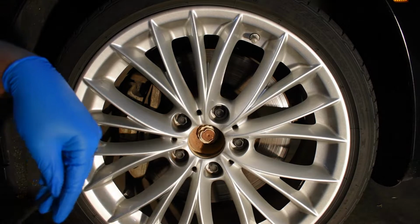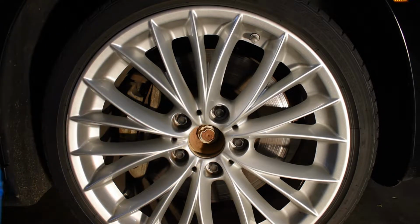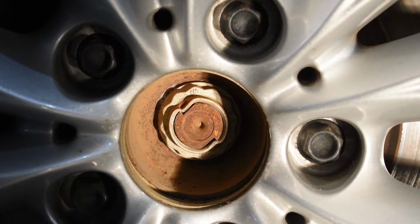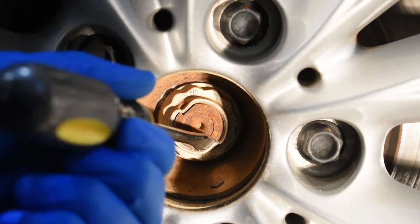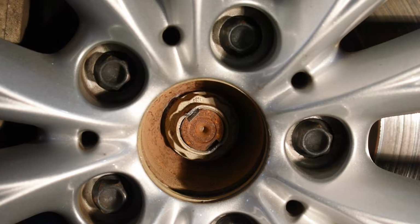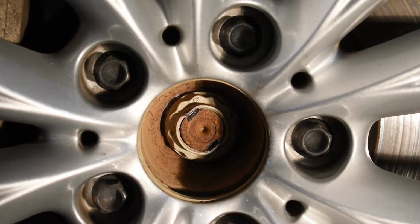Alright, before we lift the car up off the ground, first thing you want to do is remove the center cap covering the axle nut and then unstake the axle nut. To unstake it, you can just take a screwdriver or a punch tool and bend it out of the stakes. Once it's unstaked, it's time to loosen it using a 36mm 12-point socket. I'll list all the tools that you need in the description below, by the way.